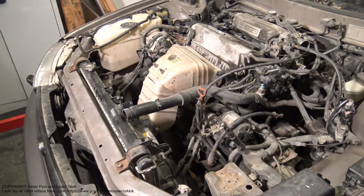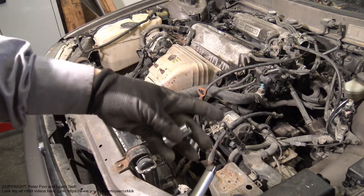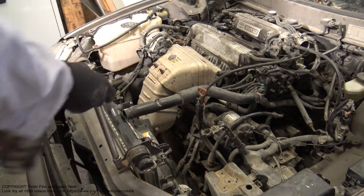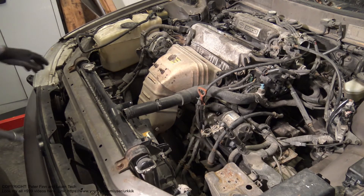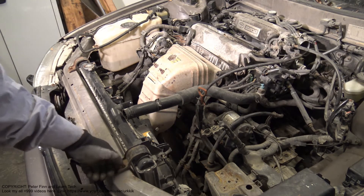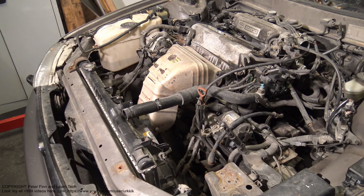The next task is to take out these metallic support plates. For that job I need a longer bar and a 12mm socket. I tip it in here — two bolts that I need to take out, they are in here. And there is this metallic support thing, in here.